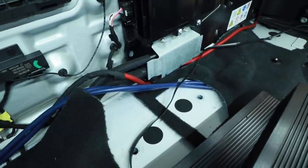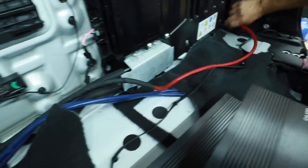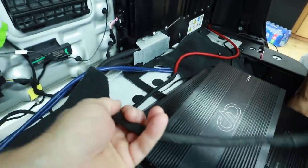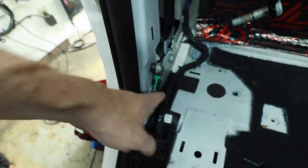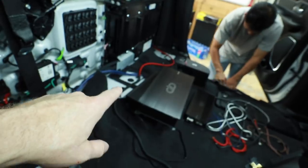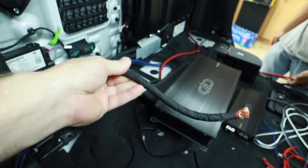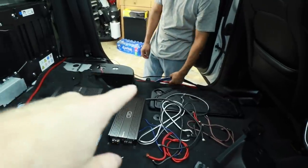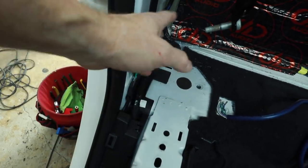Here's the power wire — there again, they taped up what you could see and not what is actually needing the tape. The whole purpose of tape is not for visual. That part you can see is perfectly safe. You tape up the wire so when it goes behind the panel — just like the factory does — it doesn't get rubbed on, doesn't get cut, and doesn't get damaged. This is not for beauty. For all you guys that are just taping the last six inches of wire — stop doing it. Stop wasting the tape. Tape either the whole wire or don't bother, because you're doing absolutely nothing. The factory tapes up their wire, you tape up your wire. That's it.